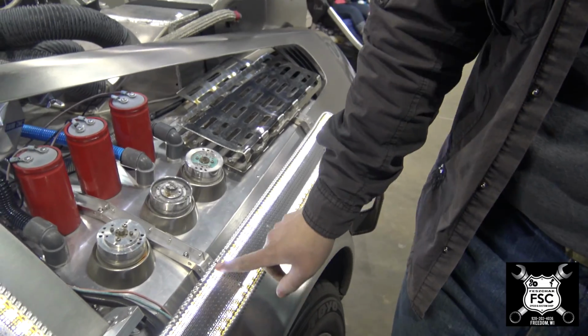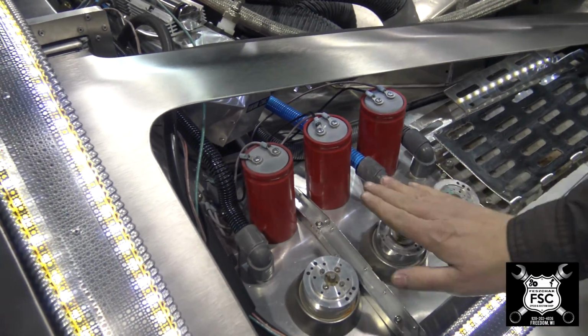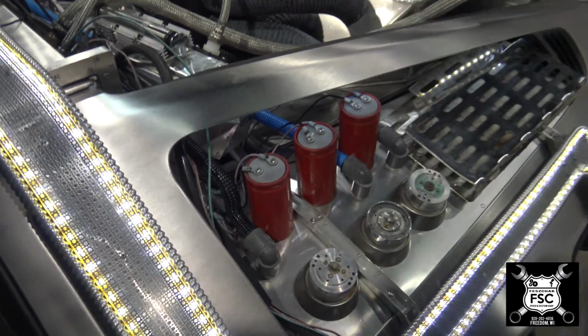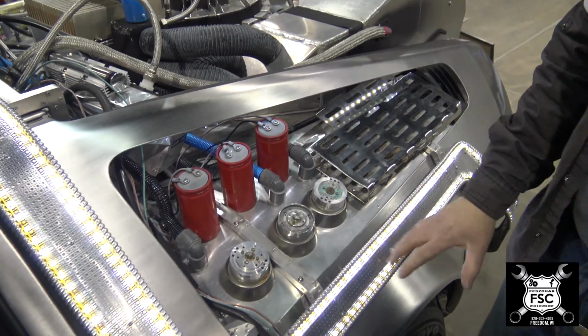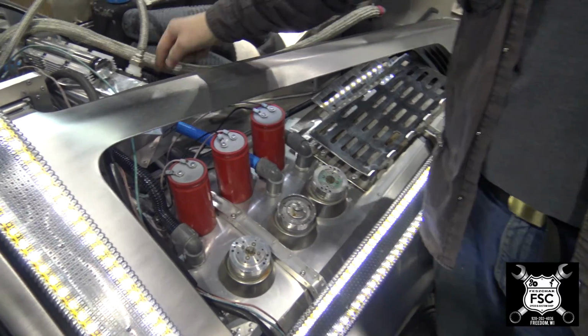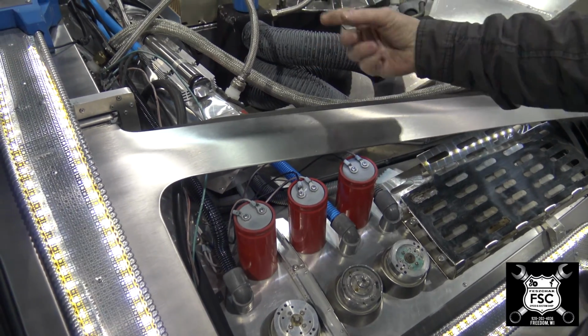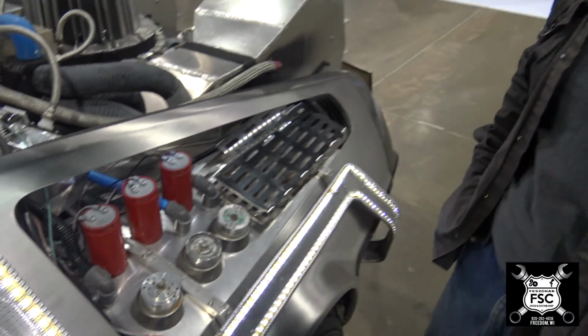This bracket's got a weird shape. It's one bracket. It goes from this side to the other side, so it follows the profile of the body, which gives it weird shapes, and it was very tedious to get those angles to match. It's using the bolt hinges of the engine deck to hold itself down. So no holes were drilled in that area either.